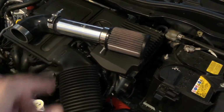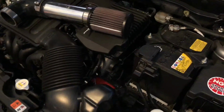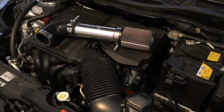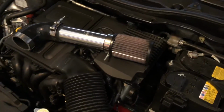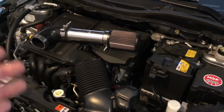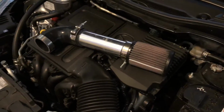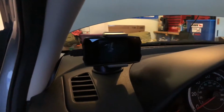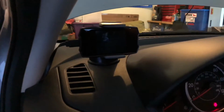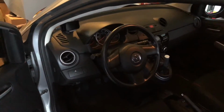Before making this modification to my intake, I hypothesized that I could get the same result as a cold air intake without having to spend almost $300. And while I can't afford to buy those other two cold air intakes and test them side by side on a dyno, I did get measurable results. Thanks to the readout on my turbo gauge OBD2 screen, I can see air intake temperatures in real time. Well, at least what the car would have me believe is the intake air temperature.